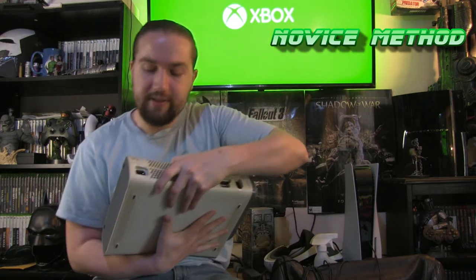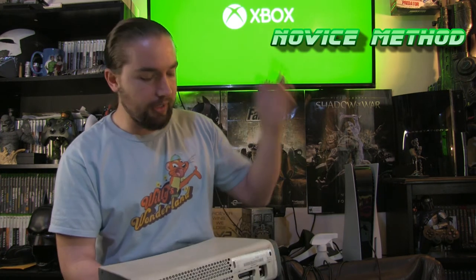To cool it, avoid third-party USB coolers or ones that hook into the power source because it just causes the power brick to work harder. Extra clip-on fans usually don't do any good either — more fans would seem to work better logically, but they don't. If you want to increase the airflow of cool air, get a tiny fan with a separate power plug — not in the same power socket — and have it aimed at the system. That'll help cool it off.